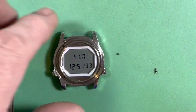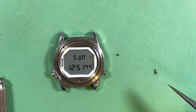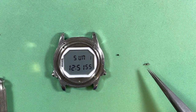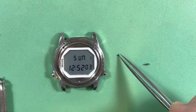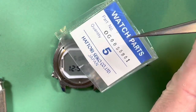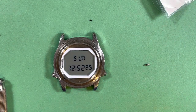One of the interesting things to me is when I find spare parts for one of these watches that was not made for terribly long and was made a long time ago. If one can find spare parts, such as complete replacement buttons — I mean they're new old stock, but that doesn't mean they're new. We have brand new pushers, and the seals, while new, are 30 years old and rock hard. Thankfully I found the nearest correct original pieces. The packet was sealed when I got it — I've installed two now and we're going to get the rest done.